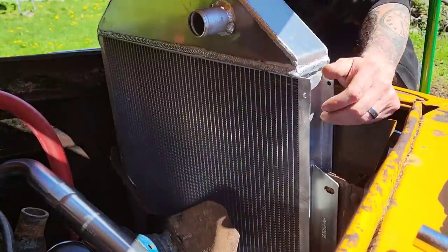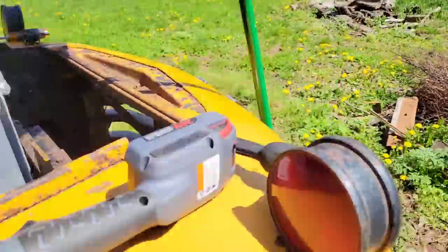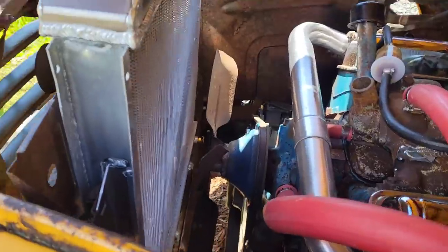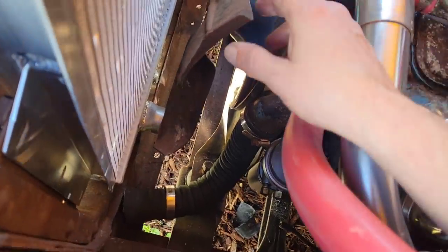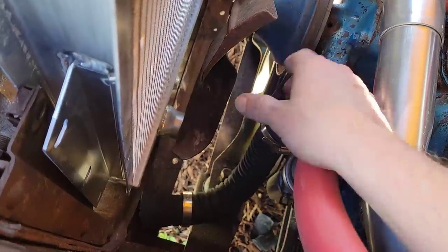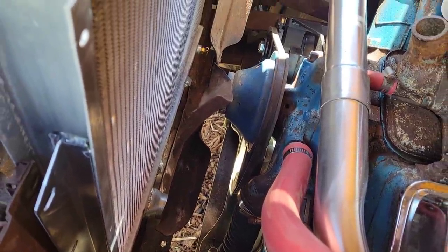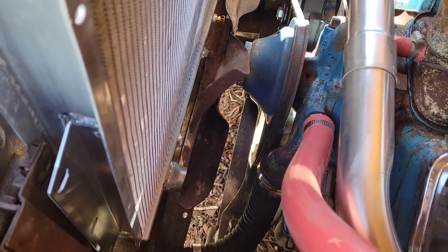Okay, that's not good. Let me show you guys what I'm seeing here. Got the radiator in there — it's pretty much a stock replacement with all the stock mounting locations, but I'm noticing that this fan is hitting the water port down there. I'm going to have to address that somehow. Looks like I might have to get a smaller fan, or I don't really want to put electric fans on here, but we've got to figure out how to solve that problem.